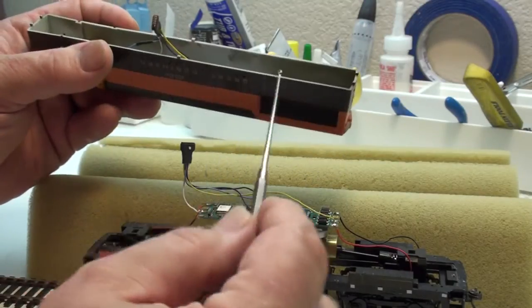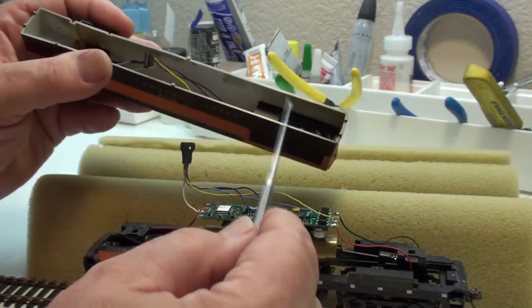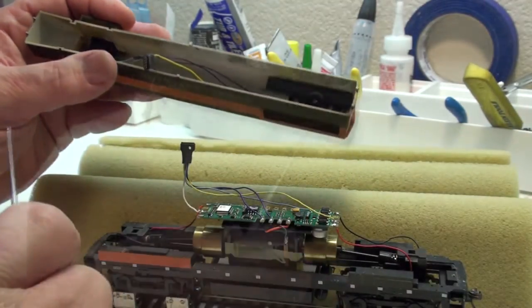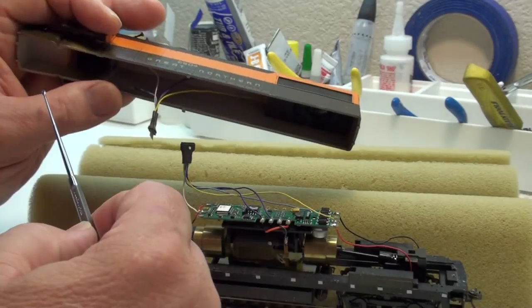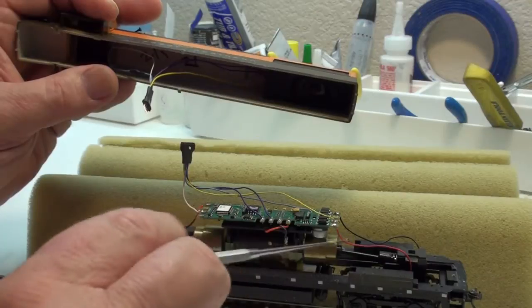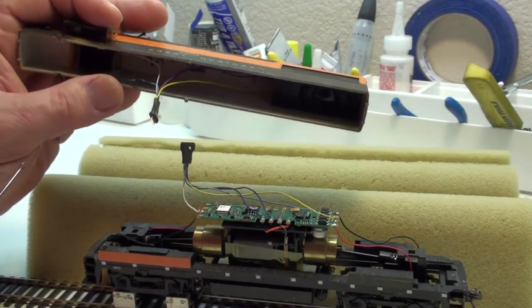What that does is it fixes it so that the negative pressure coming off the back side of the speaker has to come out through the grills on either side, and the positive pressure goes down through the truck and out through the truck over here. This distance is not the four inches that I discussed in my column in August. Part of what makes it work is the fact that there's all this stuff in the way that slows down the sound, so it isn't a free and easy path to get out.